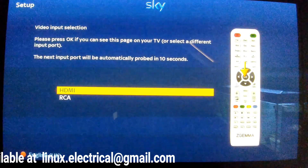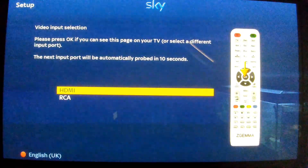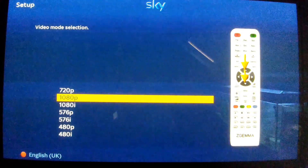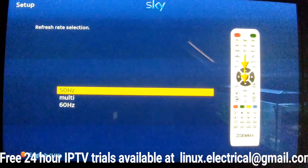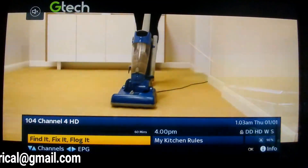You'll now see this screen — it will be flashing on and off as it flicks between options. Select HDMI (RCAs are for old CRT TVs which most people don't have anymore), highlight HDMI and press OK. Select your resolution — most TVs are 1080p now. For Hertz, most TVs are 50Hz, though newer ones can be 200-odd — just go with multi. Okay, that's done now.